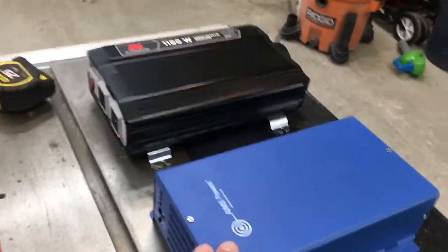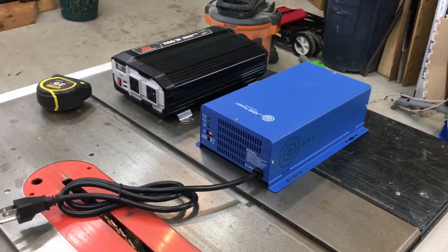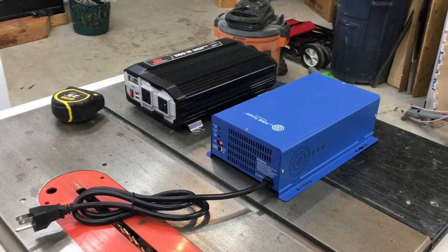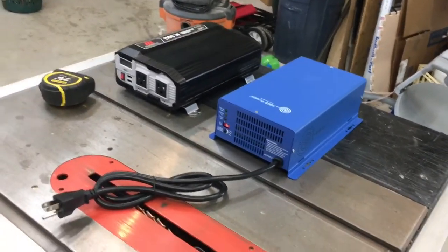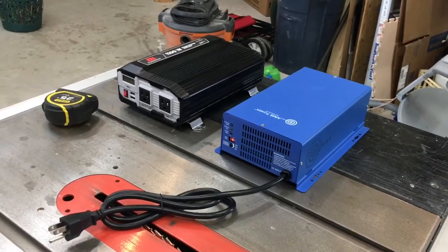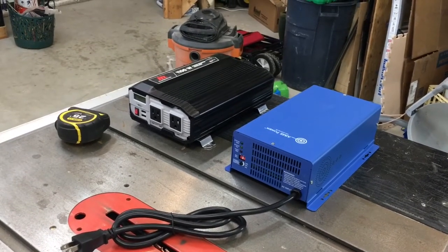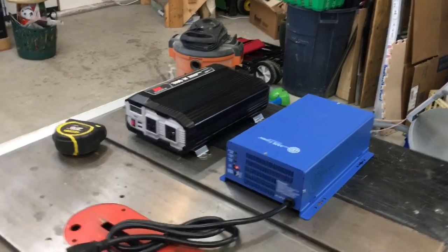What I have here are two of the main components I'd like to add to our trailer — they'll allow us to have a larger capacity battery so we don't necessarily need a service site when we go camping for a weekend. This isn't a solar setup; it's just a higher capacity battery bank. It should give us a couple of days of runtime. It won't run heavy loads like microwaves or air conditioners, but it'll keep the fridge running, keep the food cold, give us lights at night, and run the water pump.